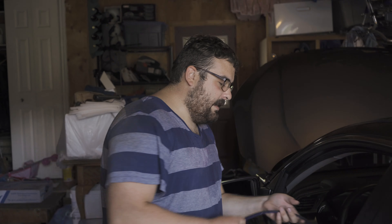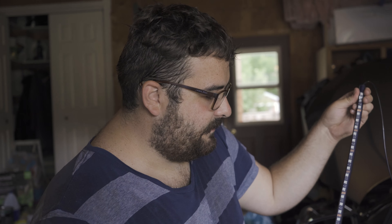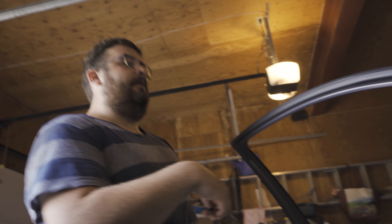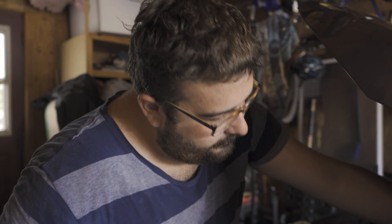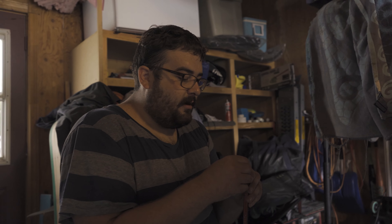Those strips on the sides are a bit longer — it's an Amazon kit, like 55 bucks. Those are for the front and back. I ran cable in through the firewall and ran a switch that comes through right here, so when I flick that they'll turn on and off. We got our two cables that ran out underneath, came behind the battery, and we hooked the battery back up.